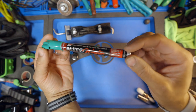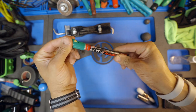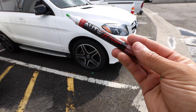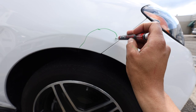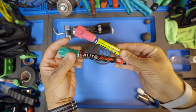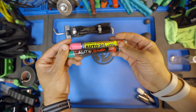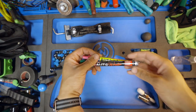This is probably a familiar tool for many PDR technicians — the Auto Writer. This is what we use for pre-inspections, allowing us to circle how many dents are on a panel or illustrate the size of the damage. I use the wedge light to see where the bracing is, then draw that on the panel with the Auto Writer. This allows the customer or insurance agent to see where the limited access and bracing is.